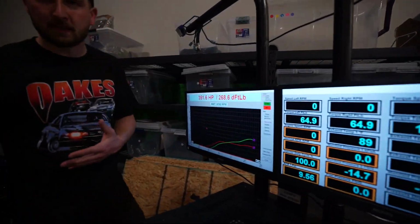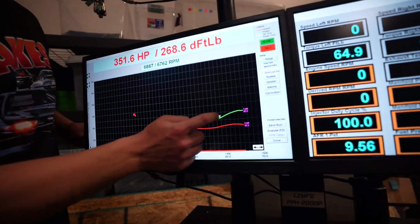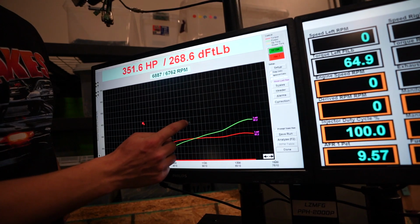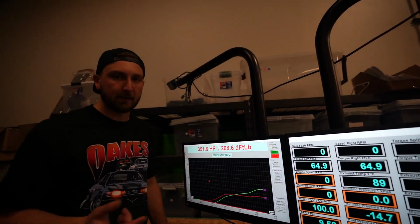All right, so here's the thing. The way it's creeping, it's actually a nice power curve, so I could bring it on the road and be fine. But it sucks knowing you don't have any control over it. If we just had a big wastegate spring in it, you wouldn't really see the boost continuously taper. The boost comes in really hard around 4,000 RPM. So if you had a big spring in it, it would probably go up and then kind of flatten out. So we know it's not just a big wastegate spring.